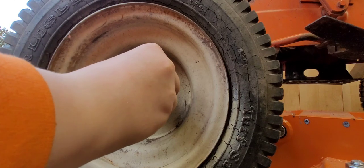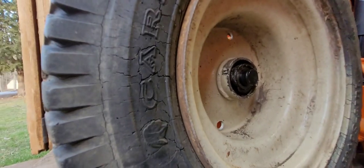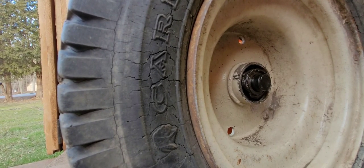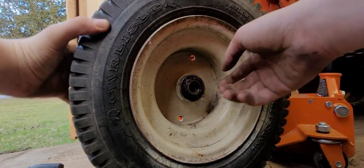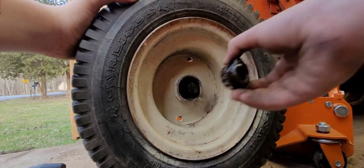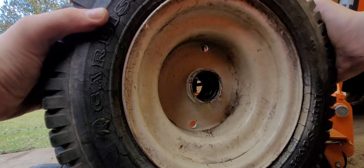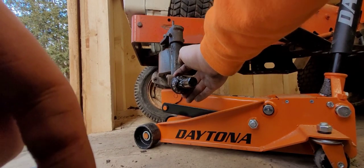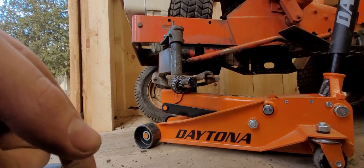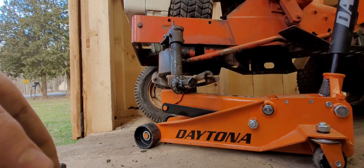Alright, now that that's loose we just pull that off, then slide stuff out of the way. I'll try that up with the hammer — actually, I'll set this inside the cap. Then you should just be able to slide that back and give the wheel a good tug, pop the bearing out. Jack it up some more — and those slides right off. Perfect, just like I wanted. It already has bearings on it, so you can slide this back on. Actually hang on — slide that off with my hands using the rag.